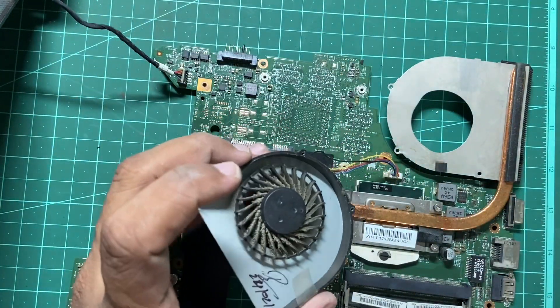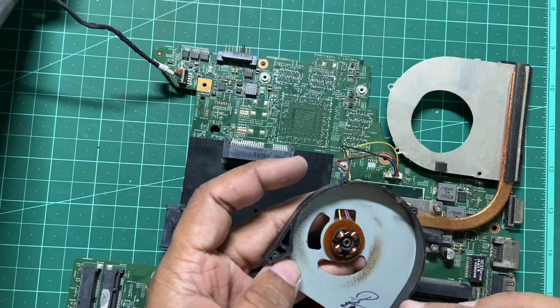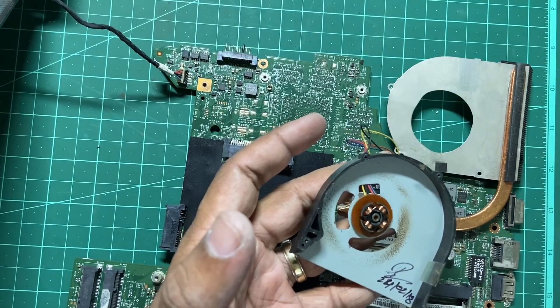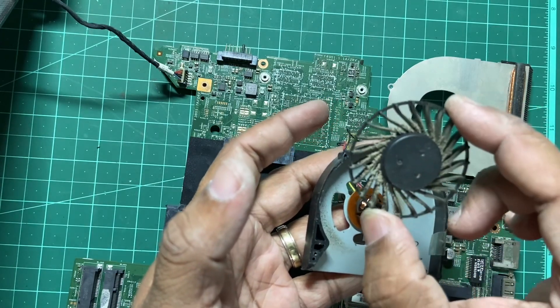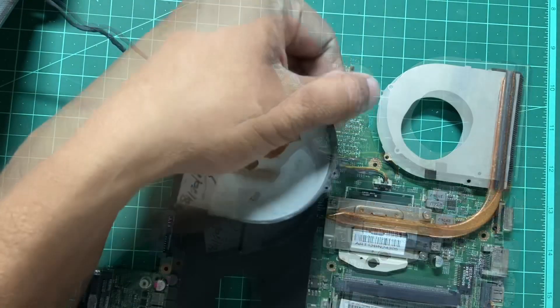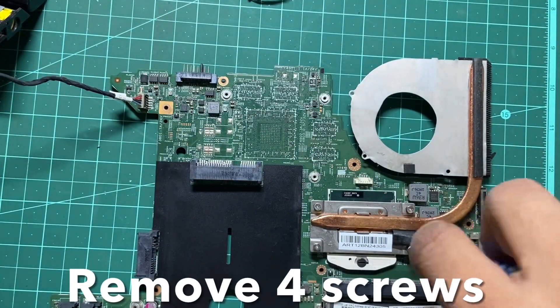Your fan is out. That's how the fan comes out. I'd suggest just clean this and maybe put a bit of lubricating oil — like sewing machine oil — so it'll get clean. This impeller, you can see, is very dirty. The fan would spring back to action. Now let's try removing the heatsink assembly — it's held by four spring-loaded screws here.